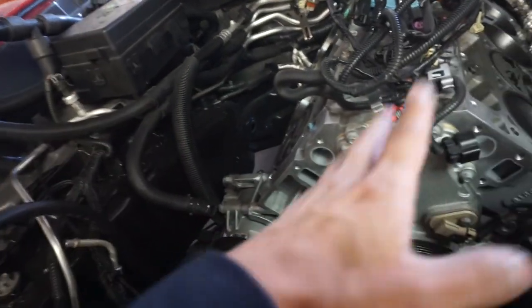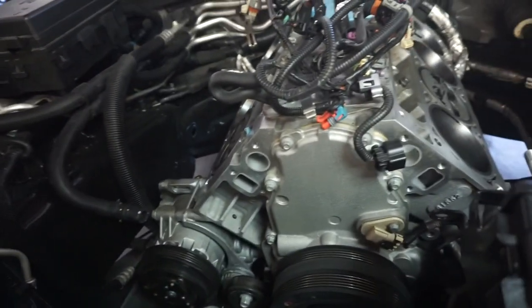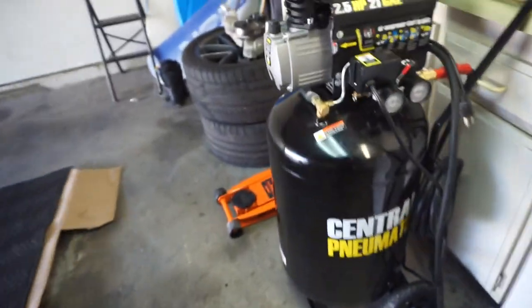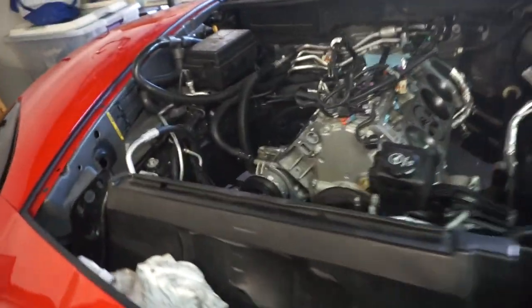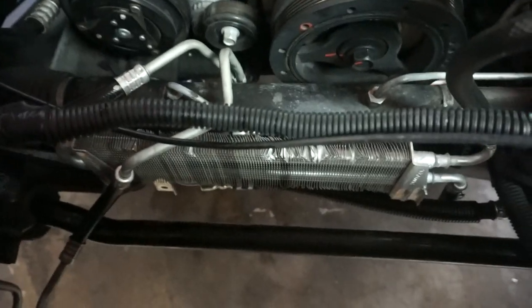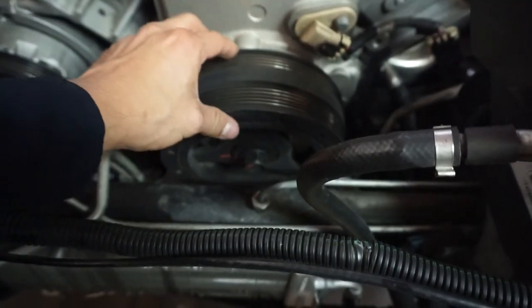You're also going to remove all the belts, all the bracketry, probably the radiator shrouds and all that stuff. But now we're going to move on to the easier stuff, which is the water pump — that's just six bolts, and it comes off. Now for the hard part: you're going to have to take off the whole power steering rack. This is pretty much why, without the rack out of the way, you cannot take off the crank pulley.